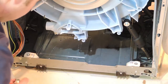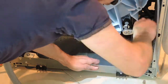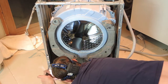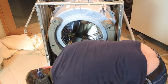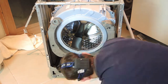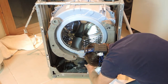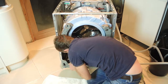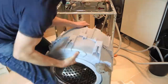Removing the retaining bolt for one of the shock absorbers, then the second bolt to remove it completely. There is a horizontal brace across the rear front of the machine — just removing that. And removing the other shock absorber at the front. This is the filter — just four screws holding it up. Then you can release the drum off its springs and pull it out of the frame.